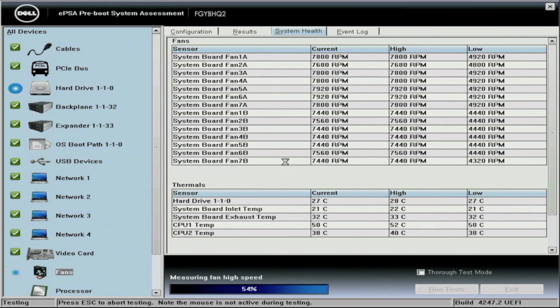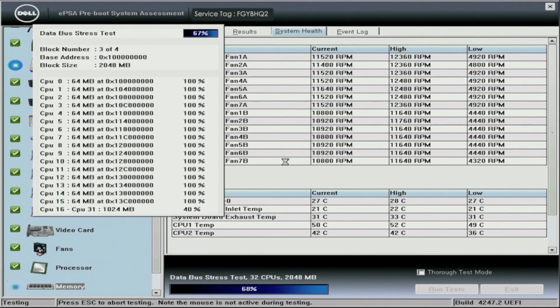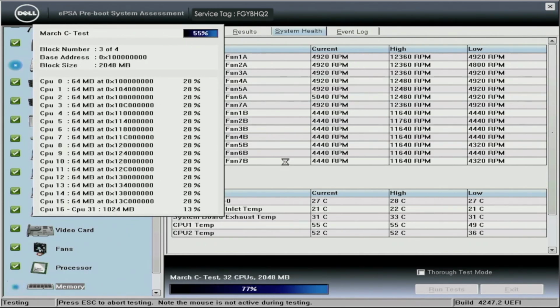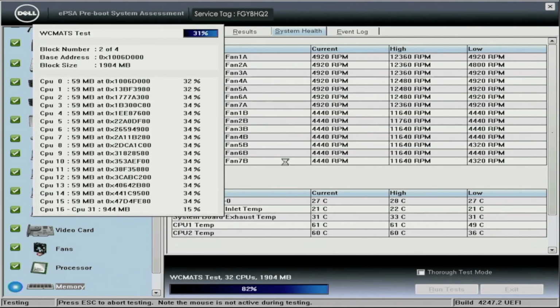One thing I do want to mention about Dell Diagnostics is that some of you out there, when trying to run the hardware diagnostics, may get an issue, or a warning about the firmware not being supported or the onboard diagnostics not being supported. In that case, you can either do this in the Lifecycle Controller itself, or in iDRAC, but you just want to update that firmware.